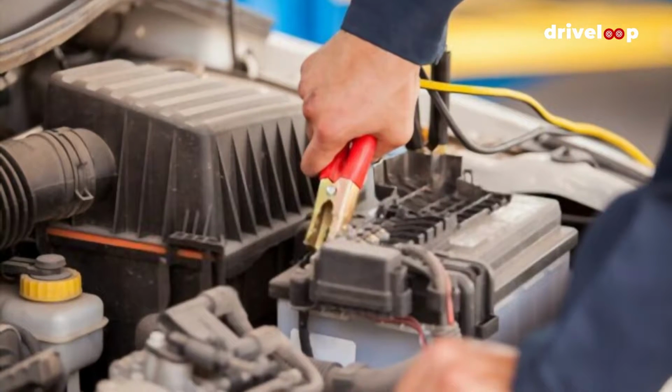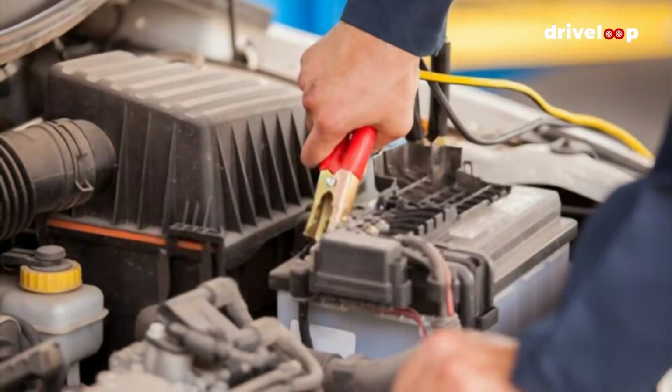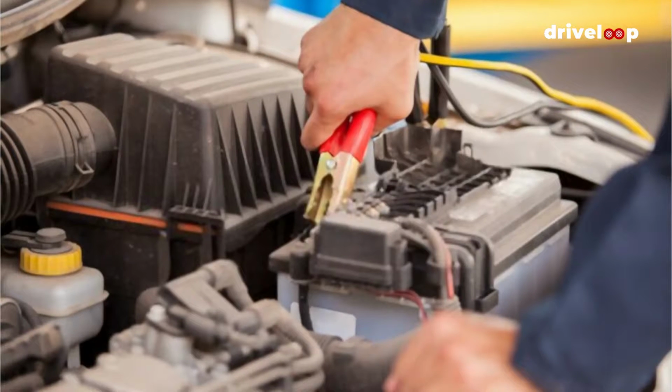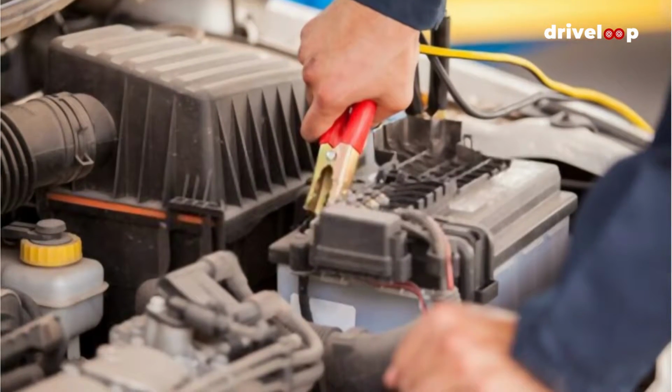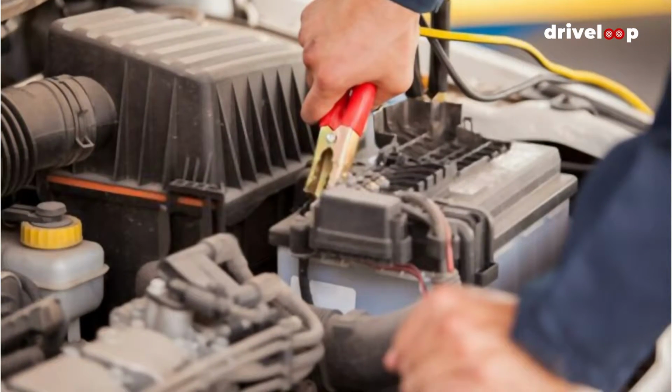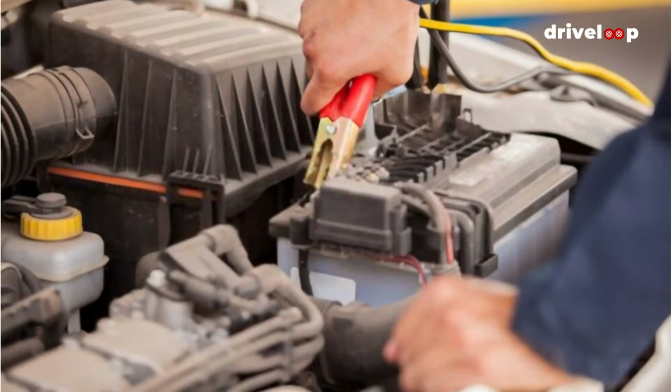Remove any plastic covers under the hood. These can be scrubbed separately. Also, remove the negative terminal from the battery. This will help protect the electrical components from getting damaged if they get wet. You can also remove the battery if you'd prefer, but we've cleaned many an engine bay without doing so.